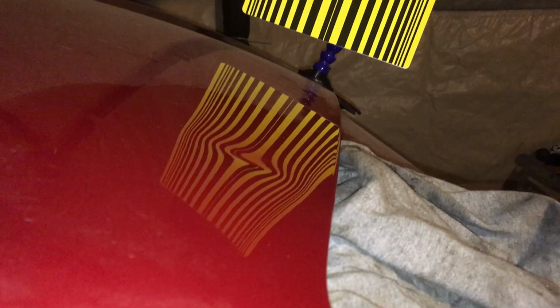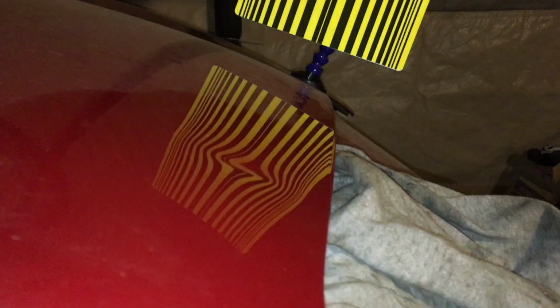It was a big chunk of redwood bark. Let me see, I have a little yellow line thing here that is used for dent repair, PDR, paintless dent repair, and you can actually see the dent, right? If there wasn't a dent there, those lines should be straight, but there's a little dent there, and the dent is actually oversized.